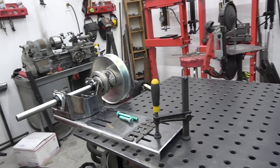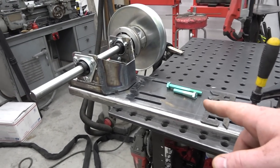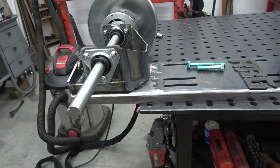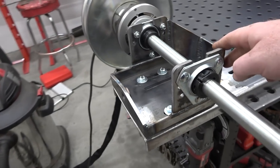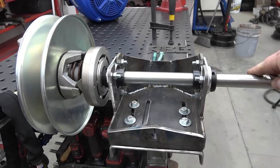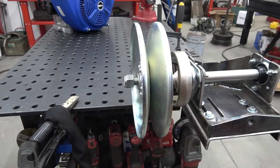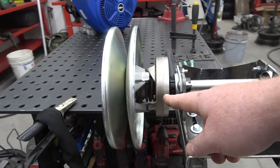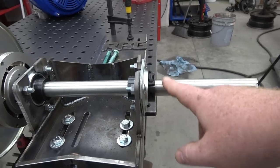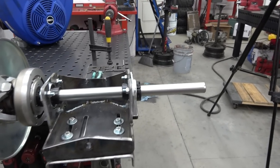We got the jackshaft plate all made up. This is just like I showed — two Go Power Sports plates. I basically cut one in half, welded it to this, then ground the seam down so it's smooth, and welded on both sides as well so it's super strong. I used that cutoff part to make the jackshaft plate. This is a one-inch live axle with two one-inch live axle bearings, so it's super strong — we'll never really bend that. We don't need another axle bearing out here; there's no shaft showing so it'd be super hard to bend. Then we'll have a double 420 sprocket out here. I don't want to run 530 or something large like that because the sprocket has to be so huge to get the right gearing.